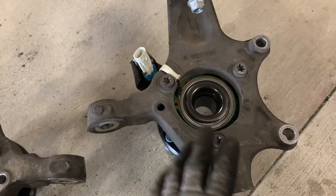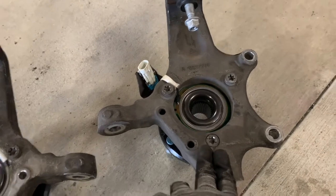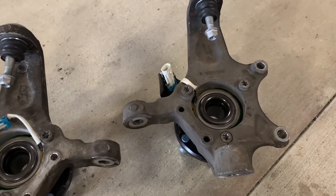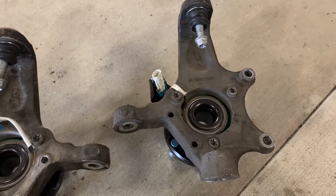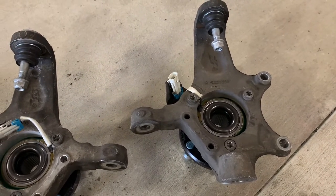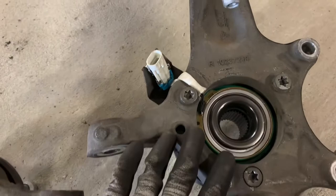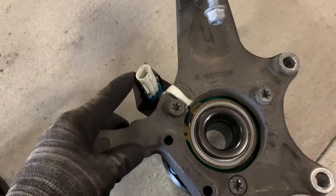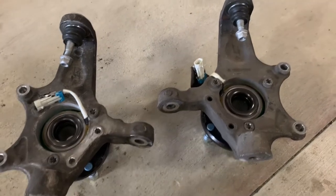This is my right front, and I'm trying something a little different this time. On my other build I actually used brake ducts, and I've had no problems at all with the brakes — they've been working great, no problems with heat in the fronts, no problems with taper. But I'm also hearing from other people who don't run them that they don't have any problems either. So I'm going to give this a try and run without them, see if I can spare myself the expense and a little bit of maintenance associated with patching holes and ducting.